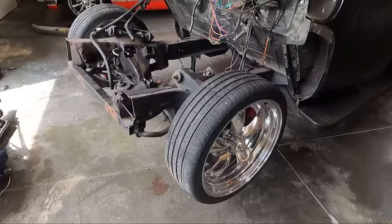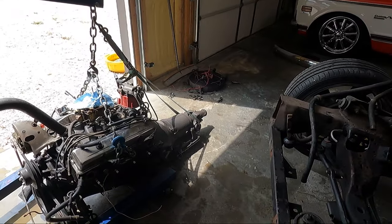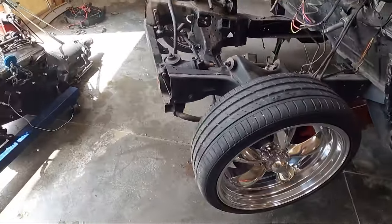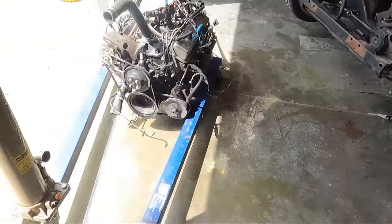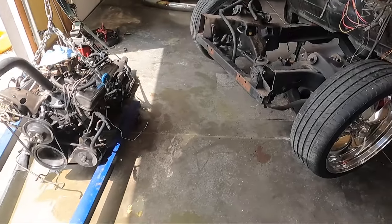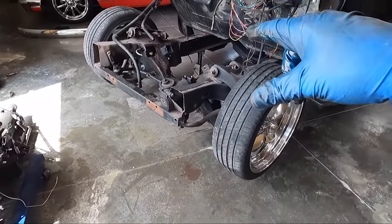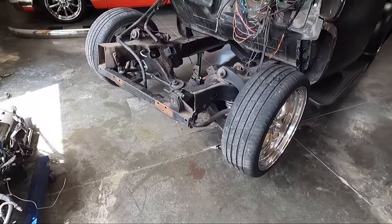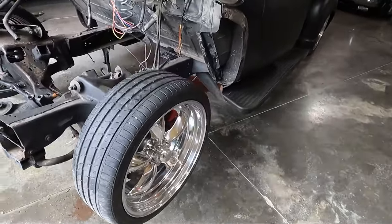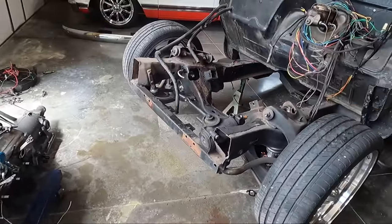It's out! I was able to clear the hood, actually. I put a ratchet strap to help level out the transmission, and once I did that everything was good — I could lower it back down a little bit once I cleared all this stuff. Now I have a big cleaning mess in front of me. I'm going to let it drain off for a while before I try cleaning any of that junk, because it's just going to continue to make a mess. I'm going to set it back down — when I do, the fuel line is going to drain. I'd like to put it on my Go Jacks wheel dollies so I can push it out of the way and still access stuff in the engine bay.